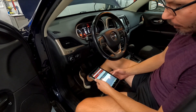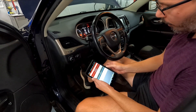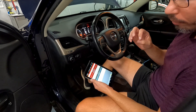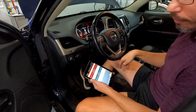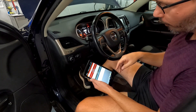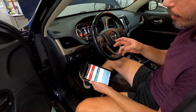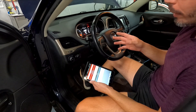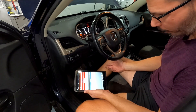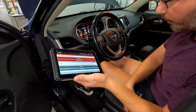That could be a wiring issue in the seat, a wiring issue anywhere in the system, or it could mean the airbag has gone bad and has an open circuit. I'm going to pull the upper cushion off the seat to see which wires go to the airbag module, then unplug the connector under the seat and check the resistance. We'll disconnect the battery first. From my airbag deployment testing work, we generally see ohm readings between the high twos and low threes. If we show an open circuit, it'll probably be easiest to find a used seat and replace the whole thing, since this one already has a tear in the seat bottom anyway.